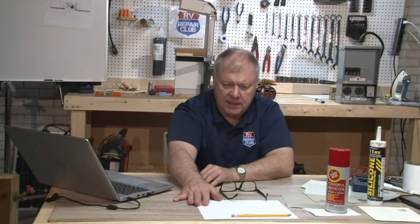If you're buying from a dealer, then I would say, I want a detailed report. I want to know who is doing the walk around, and I want a report on it. Did they check for leaks? And how did they do it? Did they do a seal tech check so I know there's no leak? Did they run all the appliances? Do I have a certification that the refrigerator is going to work for 6 months?